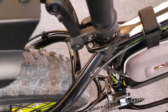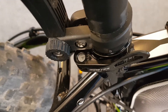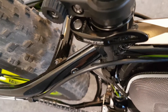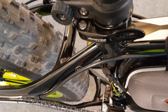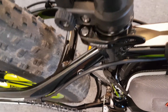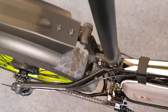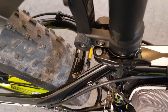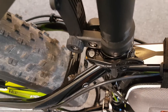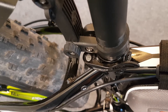The clamp for the seat post I will be changing as well, mainly because I don't want a quick release clamp. Once I find the correct seat post position I won't be changing it, since I'll be the only person using this bike, and the quick release mechanism makes it too easy to remove and steal the seat post and saddle. I'll be changing that to a regular clamp which also has a rubber seal to keep out water and dust.